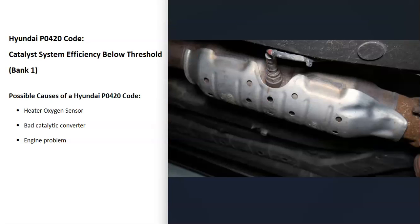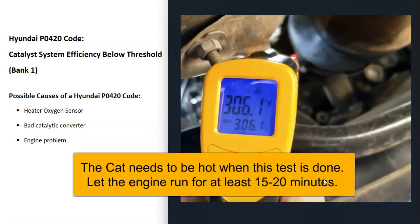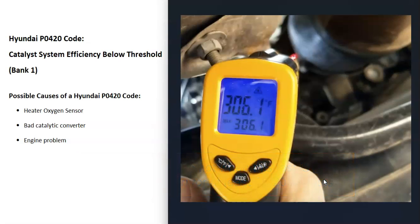If you go through and test those O2 sensors and know they're good, then the next thing that's going to cause this problem is an issue with the catalytic converter. There are different ways to test this. If you have a good OBD2 scan tool, you can look at the heat of the O2 sensors and see if heat is building up before the catalytic converter rather than after it, because quite often these get clogged up and that's exactly what happens. You can also use a low-cost infrared temperature gun to measure heat before and after the catalytic converter — if it's hotter before, that's a sign it's clogged and has failed.